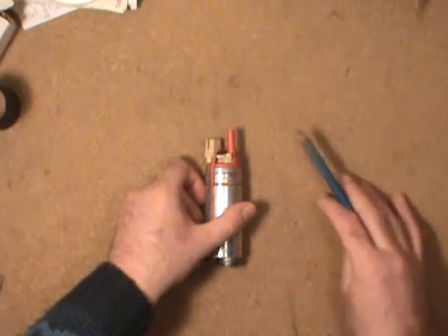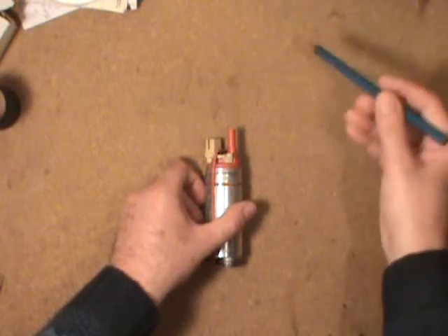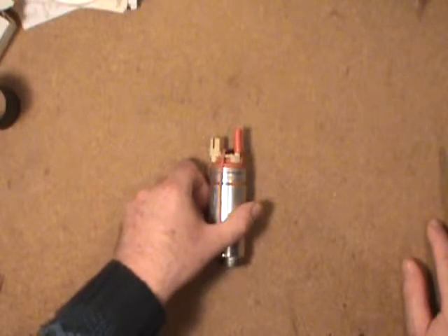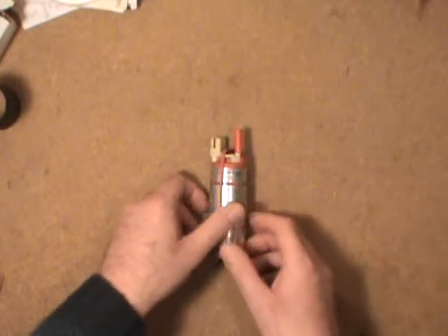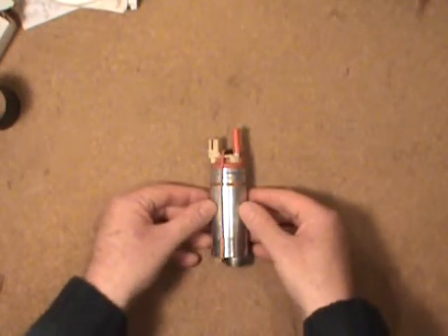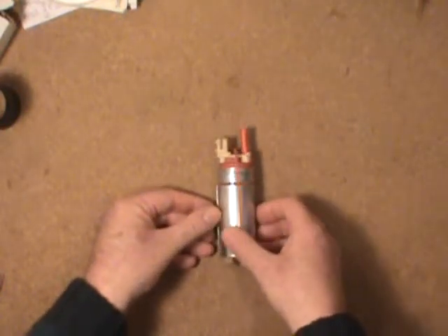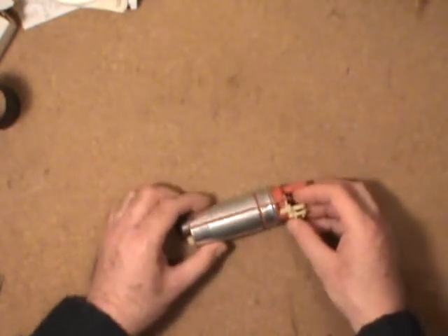The steel line reconnects as a fitting on the part with the fuel gauge sender. So it's all incorporated in one unit — you slide it into the tank along with the float arm for the fuel gauge sender. Okay, let's start taking this thing apart and see what we have here.